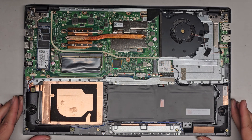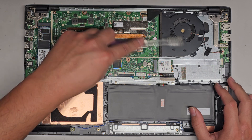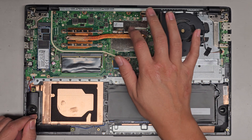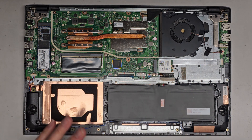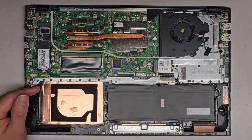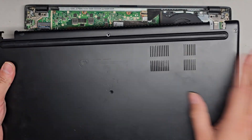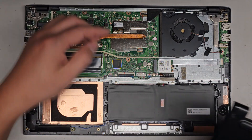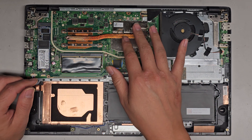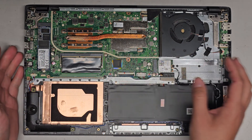This design doesn't get too dusty because it pulls air in and blows it across the heat sink here and over here. It's actually not a very good thermal design. There's not much surface area — usually a heat sink will have those little thin fins that air blows directly through, but this one doesn't have that.